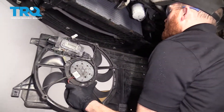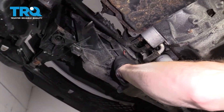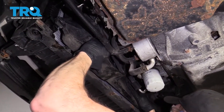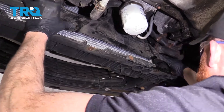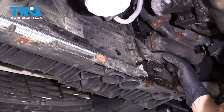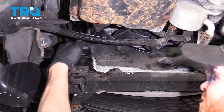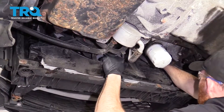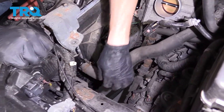Now it's time to get our cooling fan back in here. Carefully slide it up, being very careful of the brand new radiator so you don't damage any of those fins. Go a little higher than needed, then push it towards the front so that the ears can line up where they need to. Put the bottom one in, make sure the top is lined up as well, then come over to the other side and do the same thing. Once all four corners are in, pull it down and lock it in.